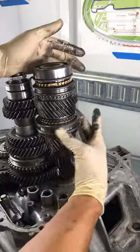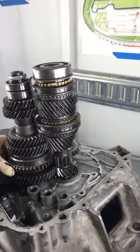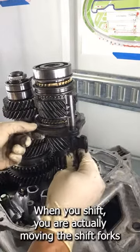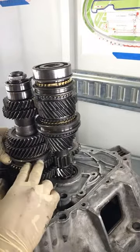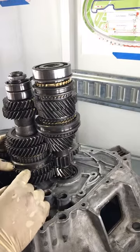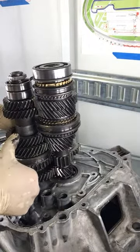This is what's called a sleeve. Let's say you wanted to go from neutral into first gear. Your shift fork, which is this guy right here, is actually attached to the sleeves — it'll attach kind of like this, and then you'll actuate them, moving them up and down. So if I want to go to first gear, I will shift into first gear, and then this thing moves down. Now this sleeve transfers torque from the gear to the sleeve to the hub, and then it'll come on out.